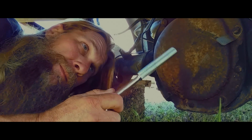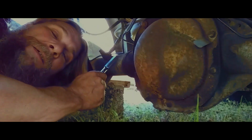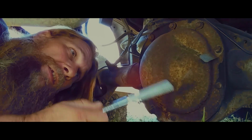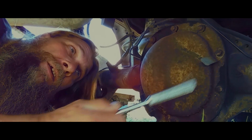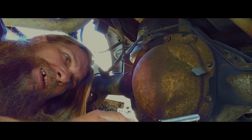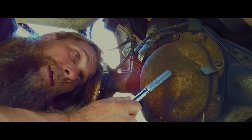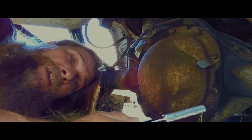It's going to help you properly identify this rear end, so that's kind of important when you buy your axle and any of these other parts that you may need, because Ford unfortunately puts a couple rear ends in their trucks, so it's not like you can just go say, hey, Ford truck rear end part, and there it is. You got to know specifics, so hopefully your tag's still there.